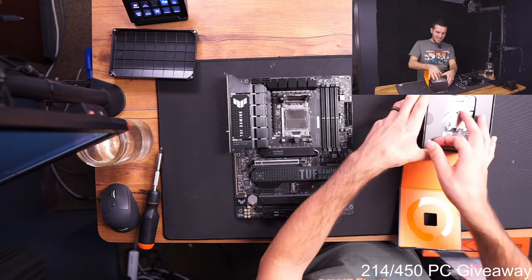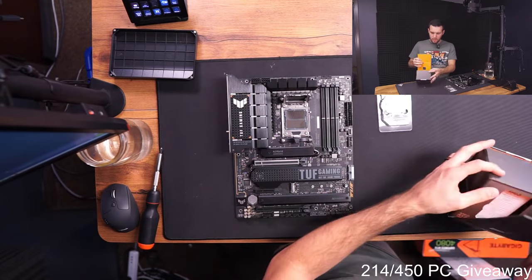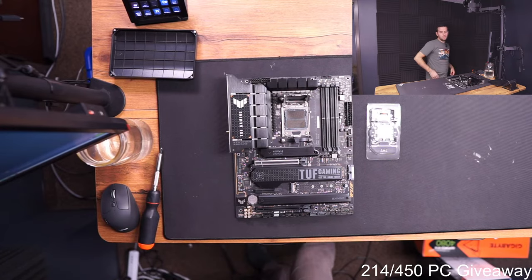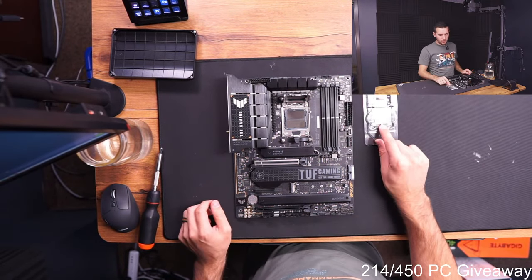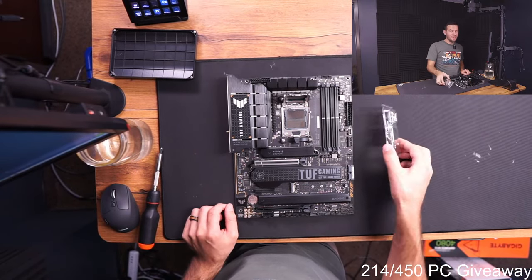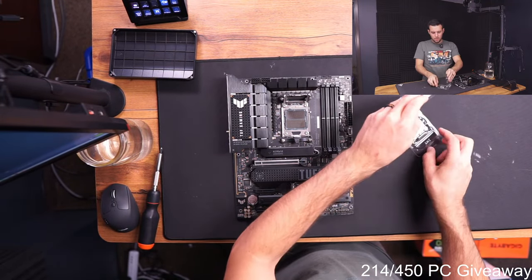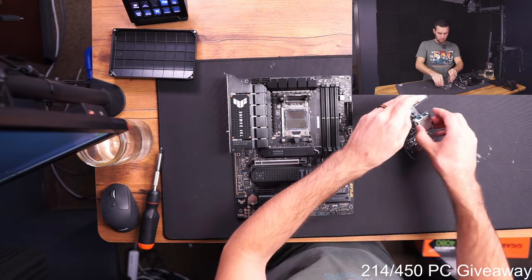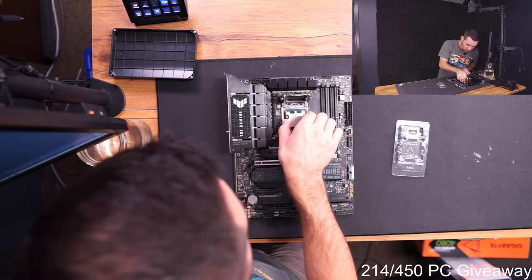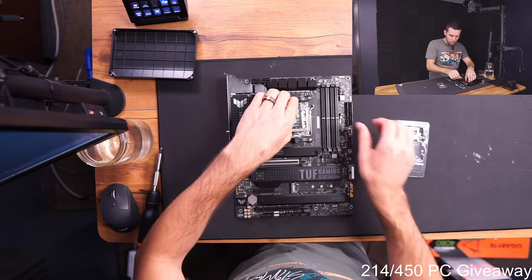Got this Ryzen 9 7900X. This is a great CPU for the purpose because he is wanting to game and stream from this one build. So while in game, he maybe would have benefited more from just a 7800X 3D, when you're gaming and streaming from the one PC, having those additional four cores is gonna be huge. It's gonna be very helpful. It'll also be nice for editing and whatever other things he might be doing. More cores equal more better.